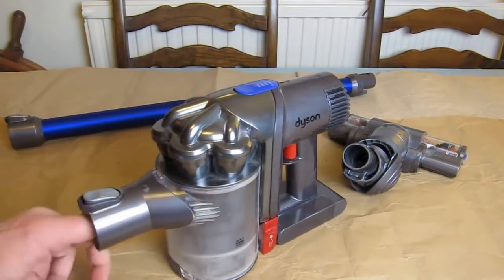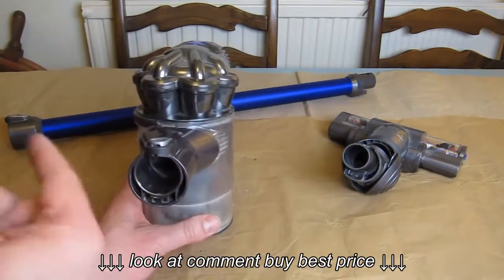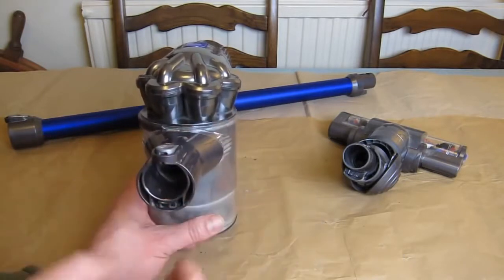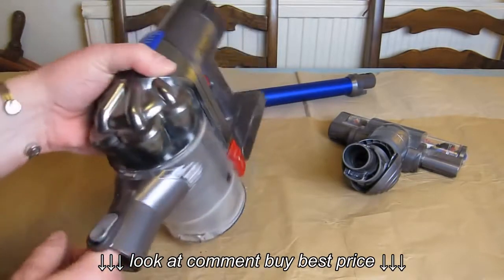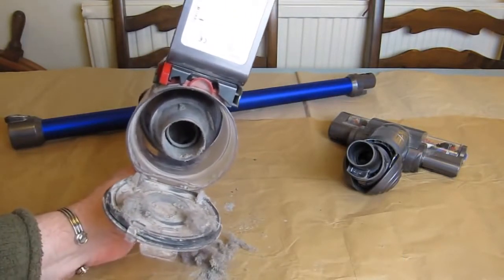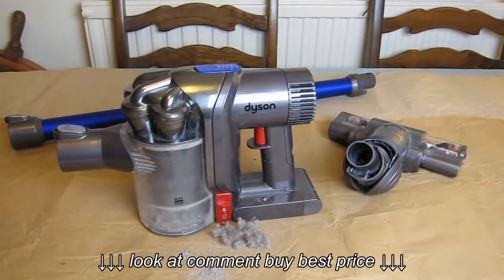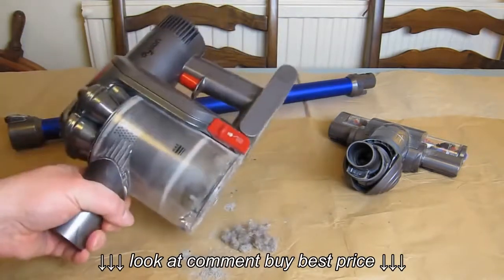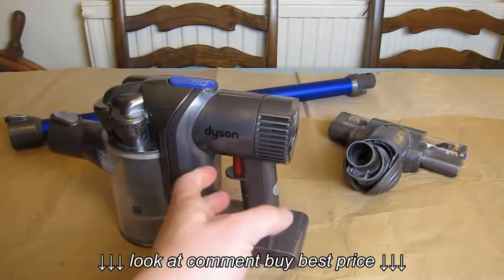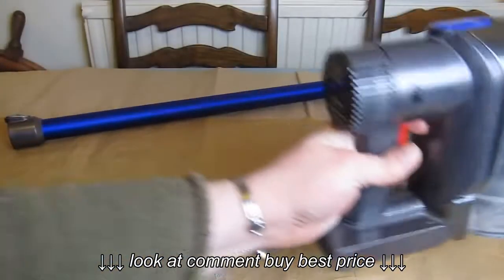You can just use your fingers here — not too deep. You'll feel that the flap I was talking about is slightly movable; it has a hinge point but only flips a little between center and the very edge. Make sure that's clear. I can poke my fingers right in — no special tools needed — and I can tell it's obstruction-free. You can also visually inspect the bottom of the unit. With all inspections like this I recommend getting a small torch to shine into the area before putting your finger in, just in case whatever's stuck is sharp or dangerous. I know the canister entrance is clear, and I know the motor is running fine.